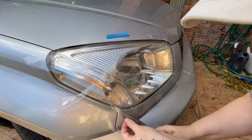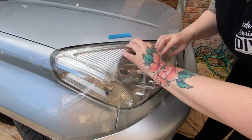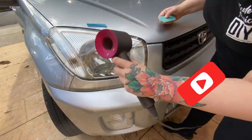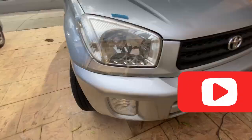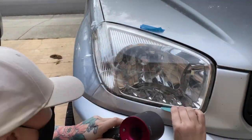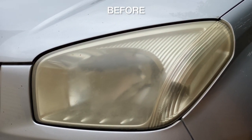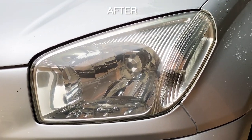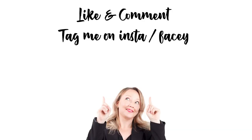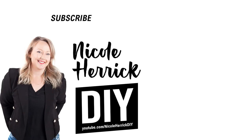Only trim up to the edge of the headlight once you get little sections that are nice and flat - if you try and do it all at once it might fall short in some places. If you've got a really wrinkly bit you can lift it up - just make sure you spray some soapy water underneath, because you should always be smoothing the water out, not air. Keep working all the way around until you get it on as smooth as you can - not gonna lie, it's really hard. Ready to see the final result after all this hard work? How satisfying is this beautiful crystal clear look! If this was helpful please drop a comment, a like, and consider subscribing. You can also tag me on Instagram if you do the same to your car. Thanks for watching guys!